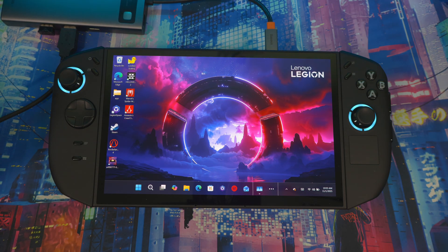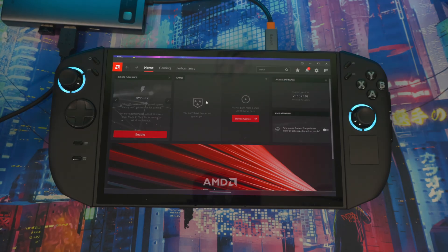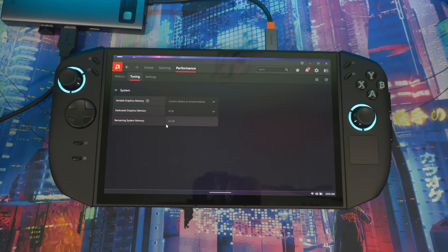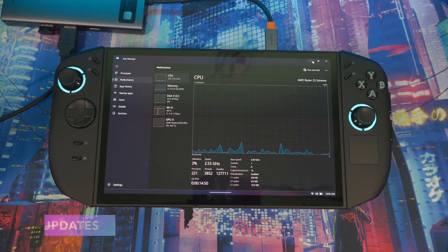In the AMD app, go to Performance, then Tuning. Here you can see your memory size and remaining system memory. Clicking on it shows 16, 24 as extra — so it's not showing me any additional options to set the VRAM differently. Now the next main thing you want to do before anything else is make sure everything is updated.